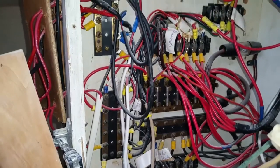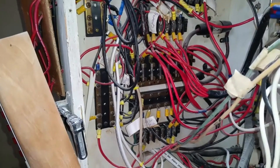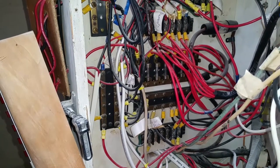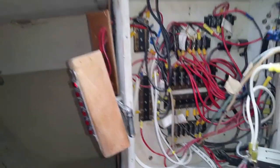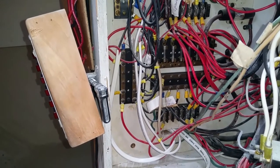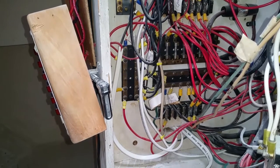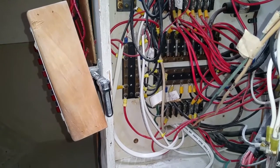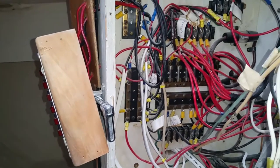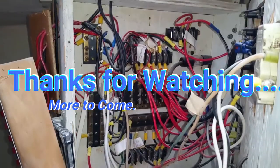I'll be tracing each wire, figuring out where it goes, and on a yellow legal pad keeping track of everything — giving each wire a numbered or lettered designation. Once that's done, what I want to try to do is use some PVC tubing that splits down the top for easy access to the wiring, color-coded or numbered. It'll be a lot easier to look at one PVC tube and say 'these are the instrument wires' than to trace each one individually. That's the plan and I'm going to get started right now.